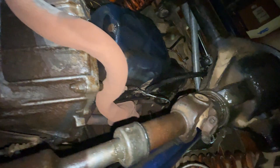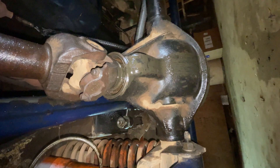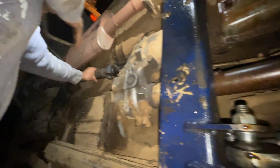The transfer case is here. The transmission from the motor puts the power into the transmission, into the transfer case. Where in two-wheel drive, it puts the power into that back axle. But when you put it in four-wheel drive, it also splits the power between the rear drive shaft, the front drive shaft, over to this front axle, which operates the four-wheel drive. But this is supposed to be very balanced, kind of like that one back there where you can't wiggle it — when you wiggle it, it's solid.